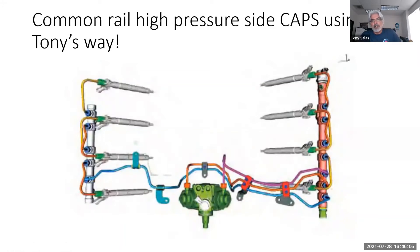Sometimes chunks of metal come out — then you tell the customer they're looking at replacing the whole fuel system: rail, lines, injectors. Yes, that's the worst case, but does it happen a lot? No. It's also a red flag when you crank and nothing comes out of the rail at all — the pump's not moving anything. If the PCV looks fine and there's no contamination, the million-dollar question is: do I have a leak, or do I have a bad pump?